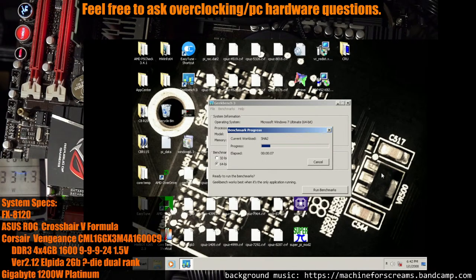Broadwell? No, Broadwell's worse. I think even Ivy Bridge is better than Broadwell. It's just that Ivy Bridge has a lot of variance from what I've heard. Some chips will really struggle to go over 2400, while others will go all the way up to 2800. Well, 5775? No. Depends what you're doing, but from an overclocking perspective, 4790K is way better. The 5775 is a good gaming CPU because of the extra EDRAM sitting on it. The L4 cache, if you will. No, from an overclocking perspective, the 4790K is better. In general workloads, the 4790K is better.